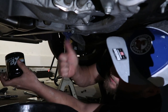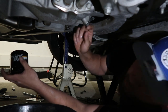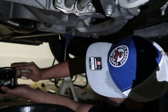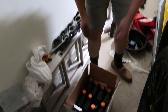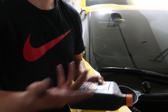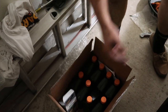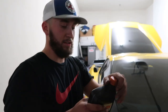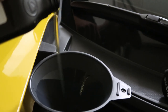We're about to wrap it up. I need to do an oil change because we removed those two lines, but it's pretty easy — just two bolts, one here and one here. Do one at a time; it's a 15 I believe. Once it's all drained out, remove your filter. It takes like 9.8 quarts or something like that. The kit is $139 and it comes with the filter and everything. This oil is like $15 a quart, so it's pretty pricey, but I've heard it's worth it.